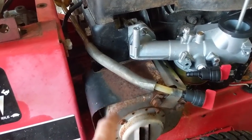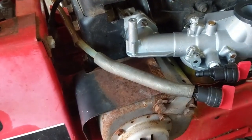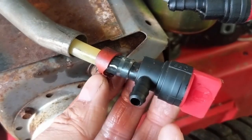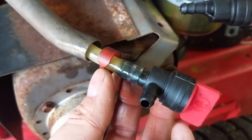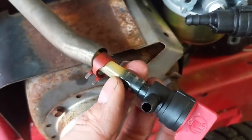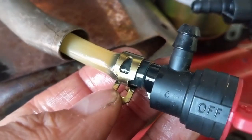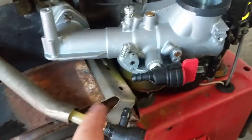With the muffler installed with its heat shield, there's a little metal pipe on the fuel line to block heat. I pulled the fuel shutoff valve off and need to install a fuel line clamp — the red clamp is loose on this Tygon fuel line because it has a much thinner wall than regular fuel line. Even though it's firmer and less malleable it needs a smaller metric clamp, so I installed a 10-millimeter metric fuel line clamp, which fits nicely.